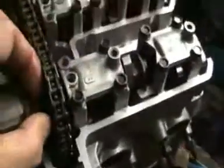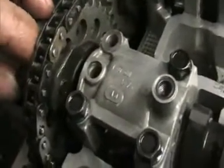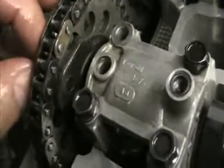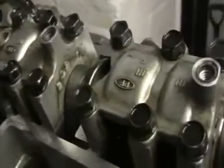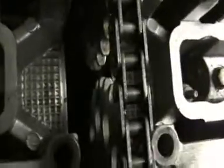And if we look here, you might be able to see it better from that side. If I start unscrewing it, you can just see in the middle. I'll screw it back up again. That one's loose as well. So what's happened is the engine's been running, this bolt's come out, splattered against that guard, and I think now that the bolt has gone down there.